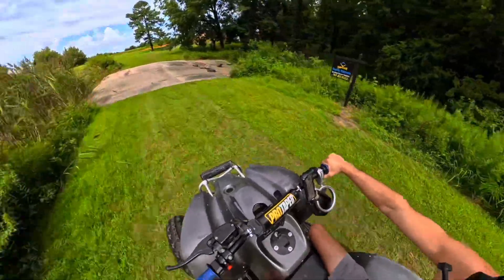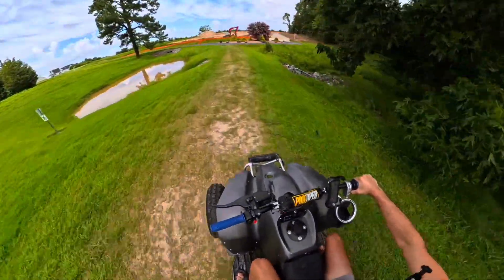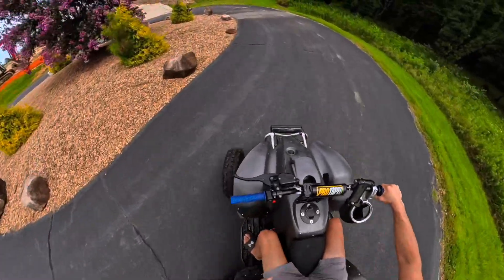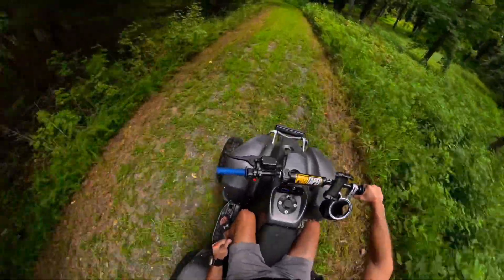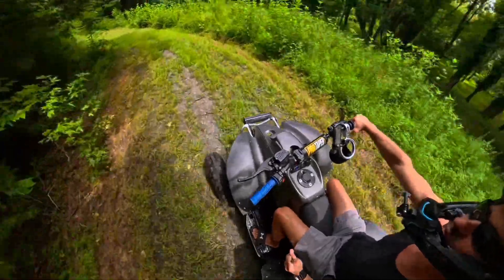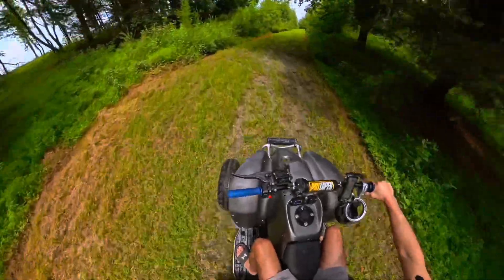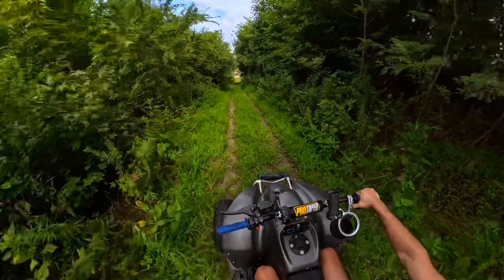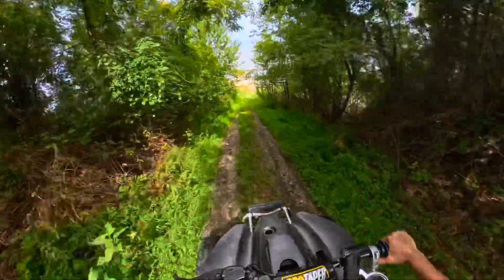For the larger vehicles, like my Murray Kilowatt or this four-wheeler, you need a lot more power for a vehicle with four wheels than two. Even if they were similar weights, the inefficiency of having four wheels means you really need to go up in battery pack size quite a bit. I would never run this four-wheeler on a single 24 amp-hour pack. I run three packs — three 24 amp-hour packs — so 72 amp-hours at 76 volts, which is almost 5.7 kilowatt-hours. These packs cost me about $900 each to build, so $2,700 total for the battery packs in this four-wheeler.